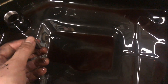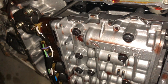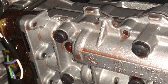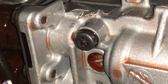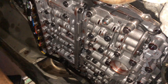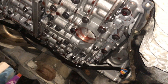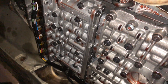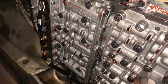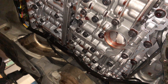Alright guys, we pulled the filter down, pan's out of the way, and I was pretty quickly able to identify up in the top corner of the lower valve body — there's a nice big chunk taken out of it and a crack going along the bottom side. I don't even know what would have caused something like that. For being just on the lower valve body, I think it's the upper valve body crack that causes the hard clunking, so I'm not sure if this is related. But we've already got carnage on the first layer of this intricate ZF lower valve body, so we're gonna keep going.